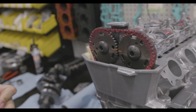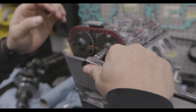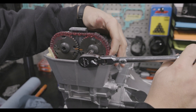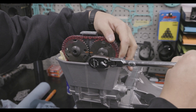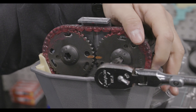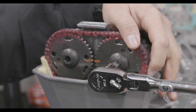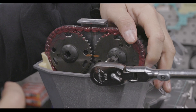Crankshaft is locked. I moved this, so now I'm going to put a little bit of tension on this and you should be able to see the cams move. They moved a bit. Now they're in absolutely perfect alignment. Just rotating them — they were sitting in a position that wasn't great alignment, and applying tension pulled everything into place.